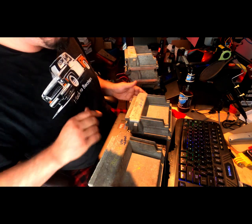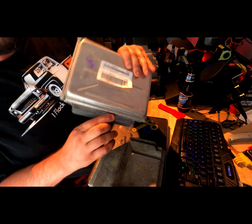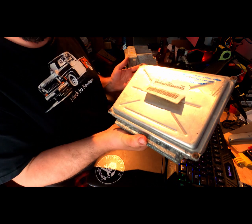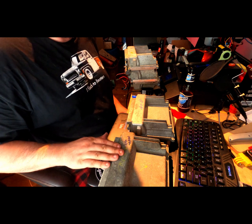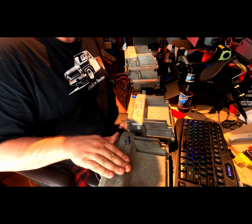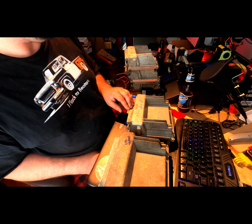The one thing that does matter — and you can't see it on this one because it's all corroded up — is the connector color. See where this says blue by my thumb? And on the back side it says green. Blue-greens are P59s, all of them. Blue-reds are P01s or 411s, all of them. All blue-red can be drive-by-wire or drive-by-cable — there were drive-by-wire vehicles all the way back in '99. Some P59s can do drive-by-cable, and all P59s do drive-by-wire.